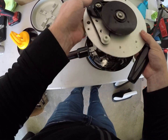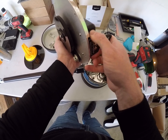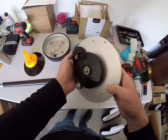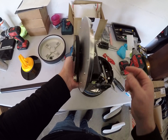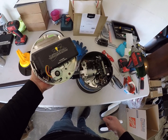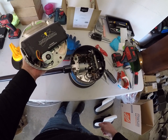You'll see the actual battery unit there. This is the part that connects the battery to power. To remove the battery on the Double One, take these screws off and the battery will just come right off. You then put a new one right in its place. You can see the inside of the robot as well.